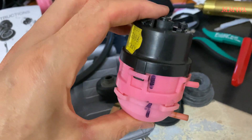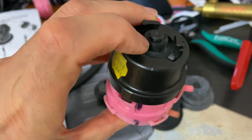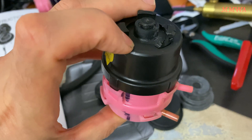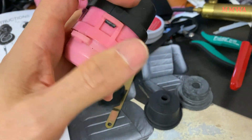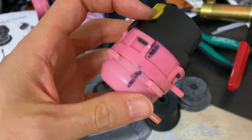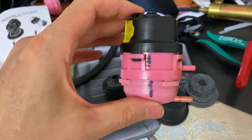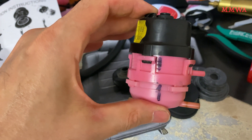Make sure it's correct because this only goes one way. If it's in the wrong direction, these vacuum ports are going to be in the wrong place, possibly even fouling something in the interior. So it's very important that you mark these and make sure they go back together exactly as you take them apart.